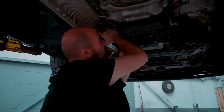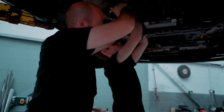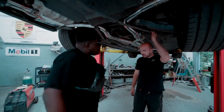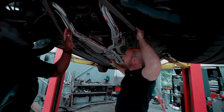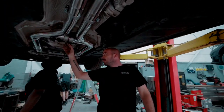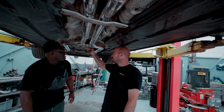We're just fitting the downpipes at the minute — one side, as you can see if you look up there, it's halfway there. On this side we're just doing the link pipes, then we can put the cap back on. So we have fitted the Fi exhaust — it's turbo-back, so it's their ceramic coated downpipes, 3-inch into a 3-inch system. As you can see, it's quite pretty. It contains the standard valve in the centre which opens and closes for cross-flow.